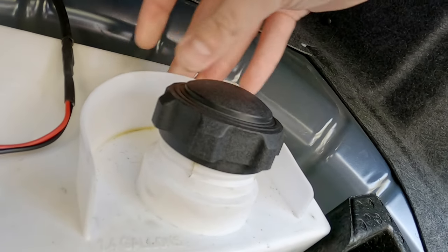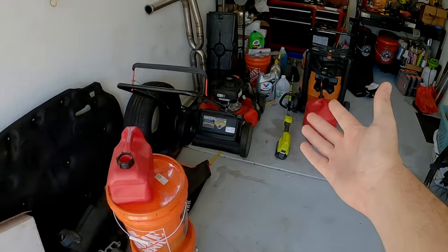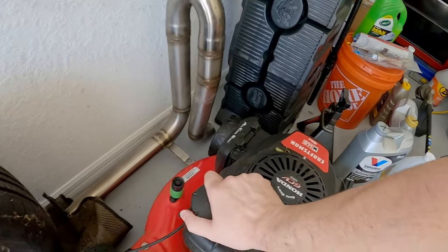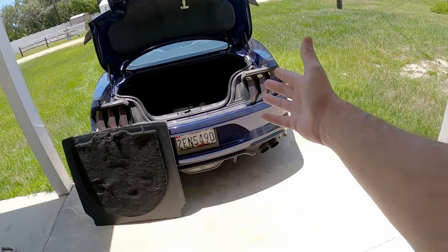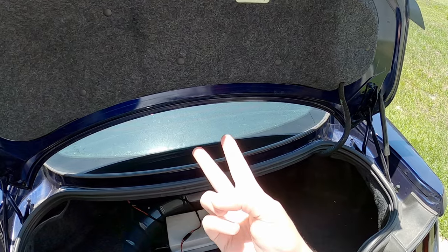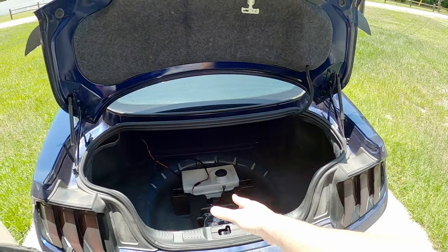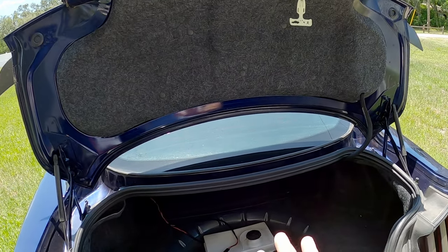Here's the air if I push on the tank. And if I plug that hole up — yeah, can't do nothing. It didn't even cross my mind. I know the gas tank in the car is vented, I understand why you vent a gas tank, but it never occurred to me that on lawn equipment the caps are vented the way they're designed. So needless to say, this just fills up my car with fumes, which is not good to be breathing in. You don't want to fill a car with combustible fumes, especially in the hot Florida summer.